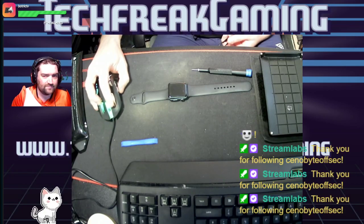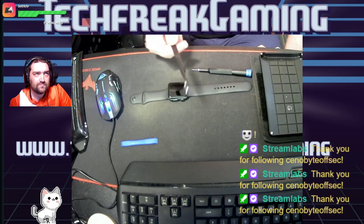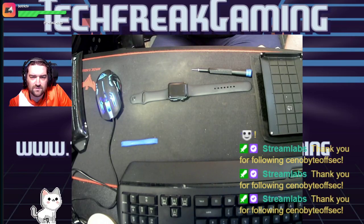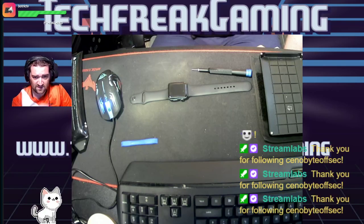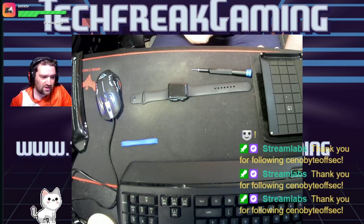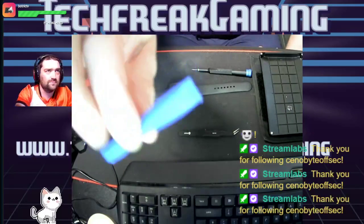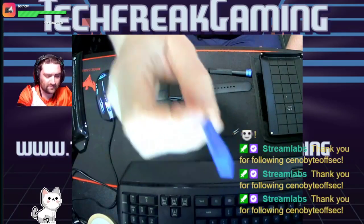Okay, so next bit. And this is the GPS model as well. So on the GPS version, it's possible to disconnect the battery immediately. For the cellular LTE version, you need to disconnect the force touch gasket and fold it out of the way first in order to disconnect the battery. Now, we disconnect the battery by pulling its connector straight up. So we're going to use our little blue doodad.